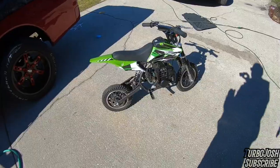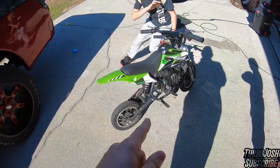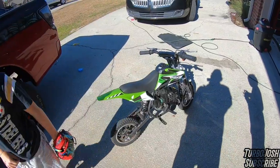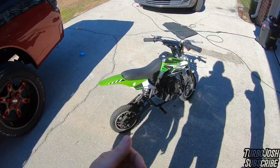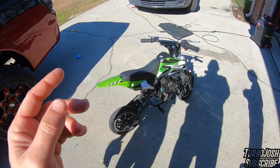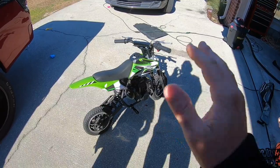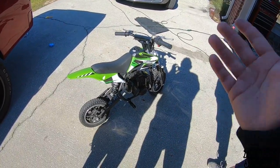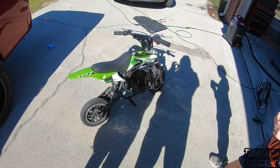Just to show you how noisy it is - we also had a total failure the other night. We were riding together, he went to turn around, and I could hear him hitting the gas. It sounded like the chain popped off, which wouldn't be a huge issue, but the clutch completely failed. A lot of that really excessive chattering and banging you hear is the clutch assembly just flopping around in there. As of right now this dirt bike is completely useless.